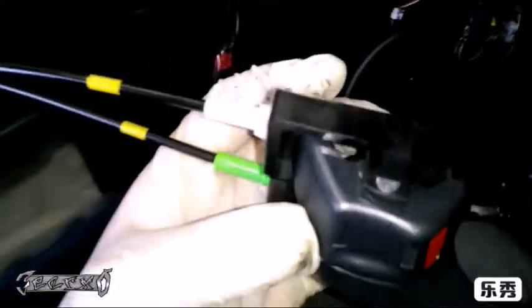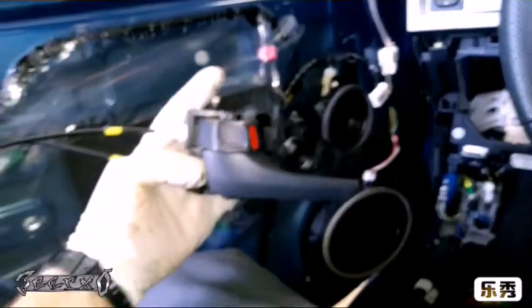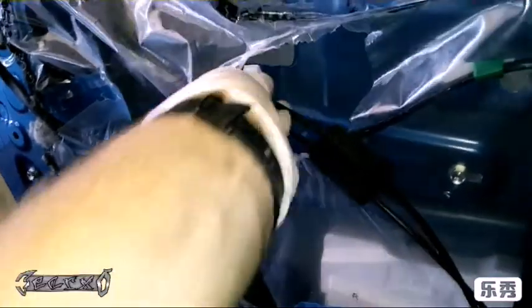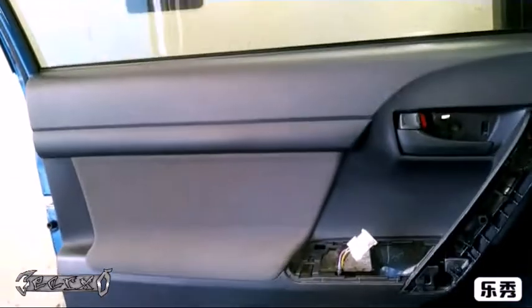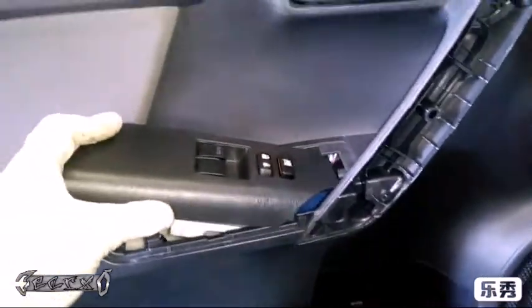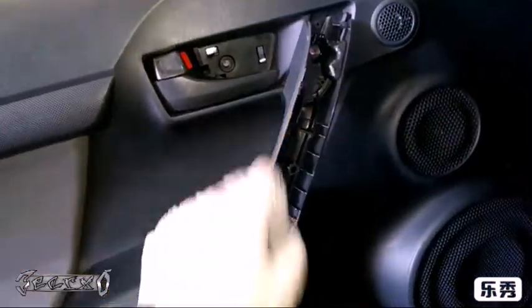Put the plastic back on, connect the connectors back to the panel. When putting this panel back in, it has little plastic notches that slide in and lock in place - be careful not to wear the notches out. Also make sure your little white clips aren't left in the door; take them out first and put them back on the panel. If you don't, your door panel will be loose. They go in this little track right here - it's important those get put in. Push the panel on, line up your white clips and push them into the holes. Nose-dive the handle piece in like this to watch out for the tab - put the tab part in first, then gently line up the holes and push down. Wiggle and gently place anything with plastic.